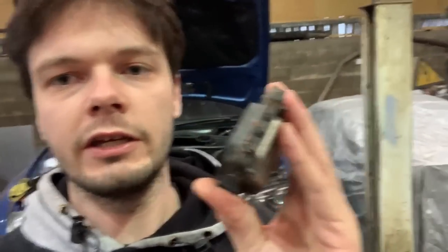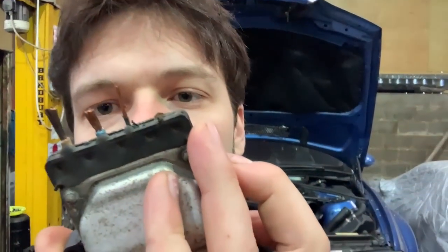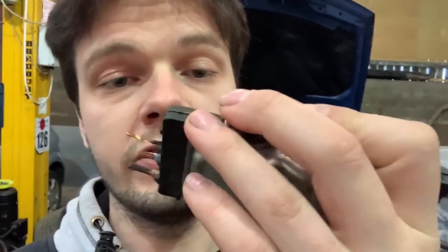The second boo-boo was I wired the fan straight into the aux controller wiring. So if I plug the fan in now, yeah, I've not done it, but if I plug the fan in now, it would just run continuously, which is not ideal. I also cut the wiring. You saw I cut it, I thought I'd boo-booed, I'd actually double boo-booed because I cut it not only a bit further up and had to re-solder it all, but then I cut it right down at the controller, which I'll show you. So this is the aux fan controller off the original radiator, and I cut the wiring, look, nice and tight.